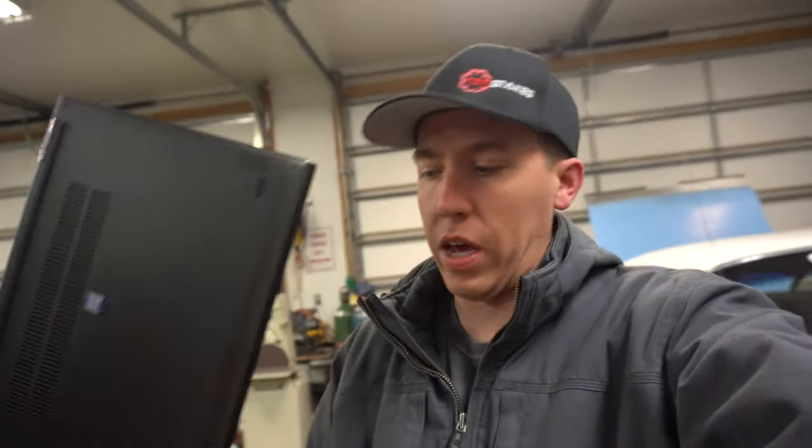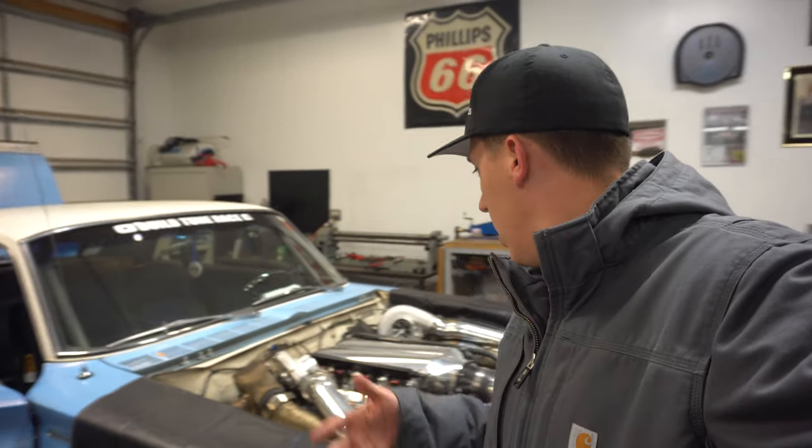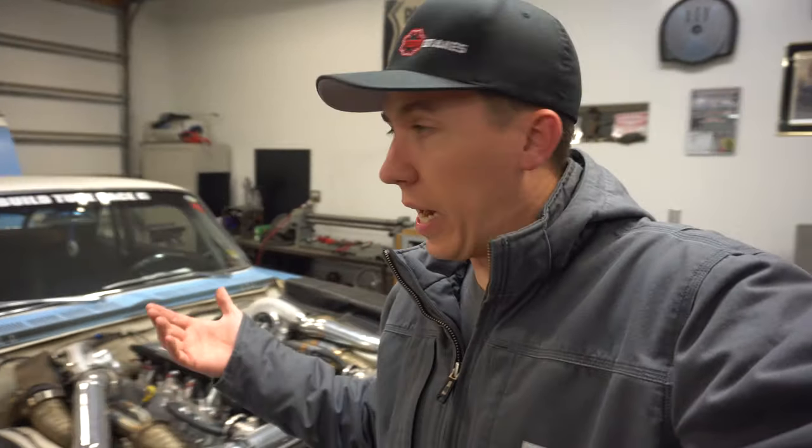Everyone, so I went ahead and saved that in the tune-up. Something to know is if you ever revert back to an old tune, that stuff won't be on there, so you could run into issues. So make sure if you ever revert back to an old tune-up that you carry over IOs and stuff that you might have added along the way. Real cool piece with the Dominators, you can always add stuff, but you've got to remember what you added. Otherwise, everything looks pretty good for idling it in the garage.